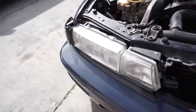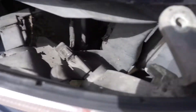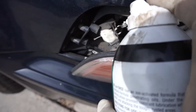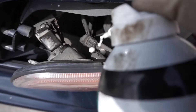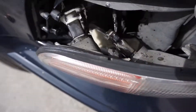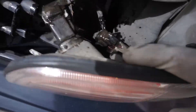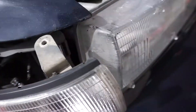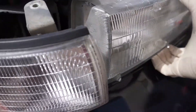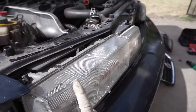I'm having a little trouble here. Tip: if your connectors are really old like mine, use some PB Blaster or WD-40 — spray it on there so you don't snap the connectors. You might snap the clips and have to buy new ones, and you don't want to do that. I got the screws out on top but it does not want to pop out, so I'm gonna keep looking for other screws that may hold it on the bottom.